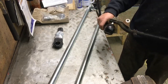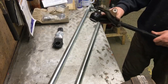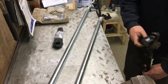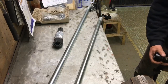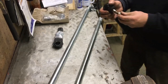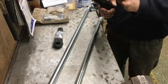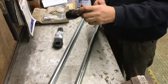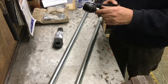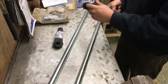The other thing is this ball joint on the end of this arm — this is from my TDCI Defender, as you all know: 2011, 16,000 miles, never really been off road. Look — that ball joint has play already; it's basically on the way out. There's a circlip in there and you press the ball joint out, which is apparently quite difficult to do. I've never done one, and I won't have to now because I've got this kit.